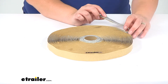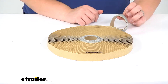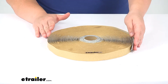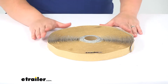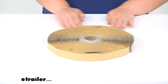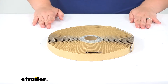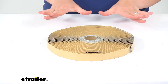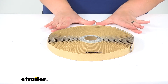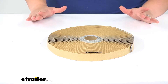It's nice and pliant whenever you're going to install this — you can just tear off a chunk to match the size that you need, and it kind of squishes down into place. When installing your hardware, typically you'll have your butyl tape down on the roof of your vehicle, put the vent over that with the shroud going over the butyl tape, put in your hardware, and then seal it off with some self-leveling sealant.